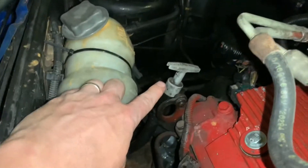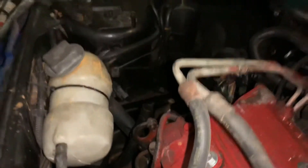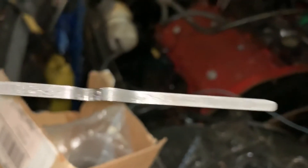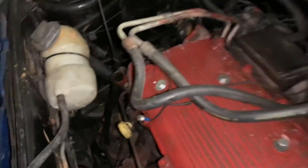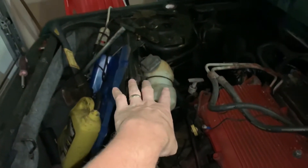Some other things we've done since the last episode: we threw synchromesh into the transmission — here's where the synchromesh goes, this is a manual transmission and also where you fill it. It's not leaking, which is the important part. It's not completely full but it's not leaking, so we just need some more synchromesh. The old transmission leaked around the seals. We also blocked off the coolant reservoir overflow tank on this side — that's going to be our high air side.